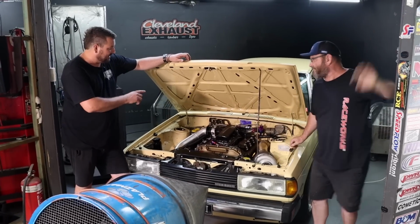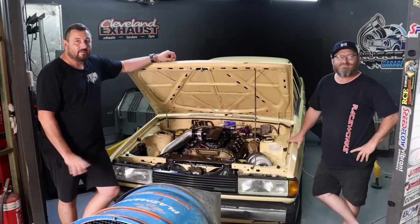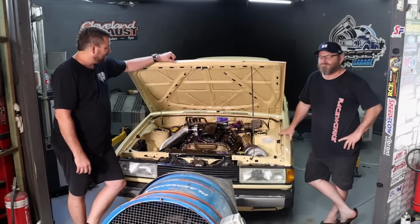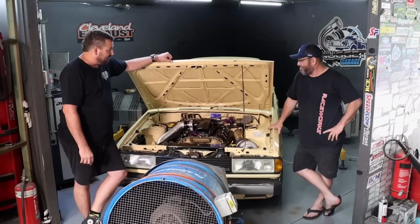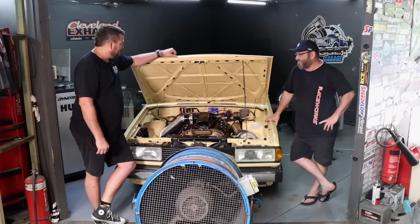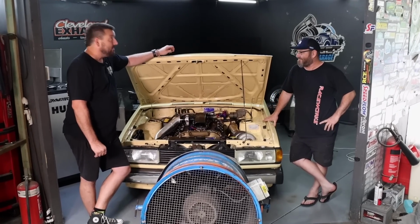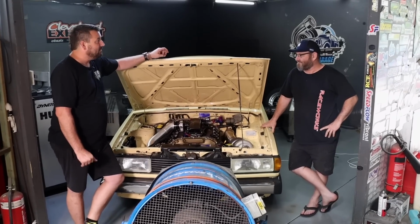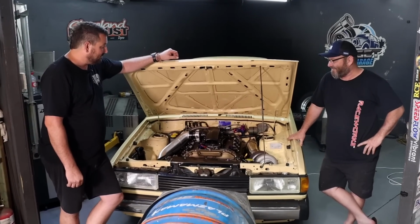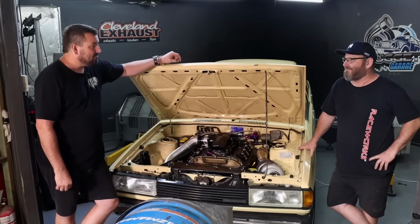And then ultimately at the end there, I think we've got one spark plug in this cylinder that's not gapped properly, so we don't have one to replace it with. Need to use that gapping station. So I think that's plenty anyway for what he needs. Happy? Coolant pressure's good. Heads are still on it then? I don't think it's overly aggressive timing wise, so I reckon it would make 800 no problem. I just tapped in a couple of numbers into a quarter mile calculator and it said at 707 that it would do a 9.0. Sounds about right.